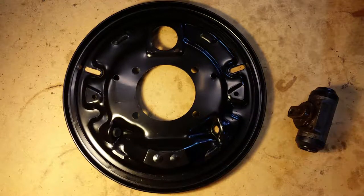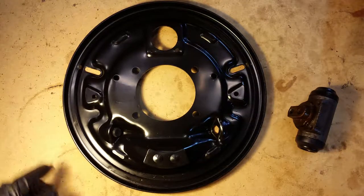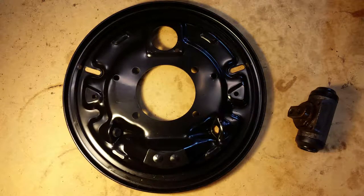If you have drum brakes on your vehicle and you're having issues with one brake overheating — specifically mine was the right hand rear brake — it was getting much, much hotter. You could touch the drum on the outside after driving for a while and it was extremely hot compared to the left side. It turns out there was too much differential fluid in the rear end, running into the left side and contaminating the brake shoes there, making the right hand rear brake work much harder to stop the vehicle.